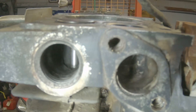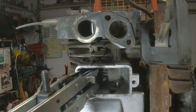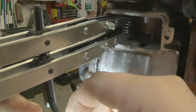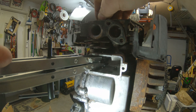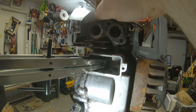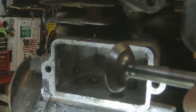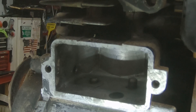I went ahead and pulled the muffler off here to make this a little bit easier to see. I also took a Dremel tool with a wire bristle wheel on it and cleaned this port out. I'm going to pull this exhaust valve out too, but I wanted to show you a little bit better about how this tool works. I've already got it slid underneath the keeper and on top of the spring. Tighten this down so your gap is set correctly, then angle it back — the opening is in the back — and that will pull that off the valve. You don't need a screwdriver or anything else. And there's that exhaust valve. It doesn't look near as bad as that intake, which to me seems odd — I'm used to seeing exhaust valves with a lot more carbon on them. Get these all cleaned up and we'll get this back together.